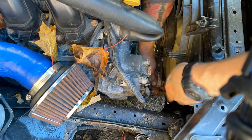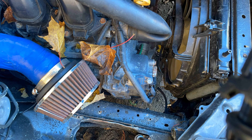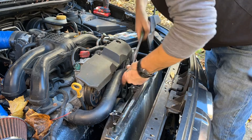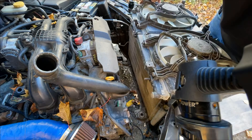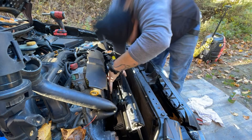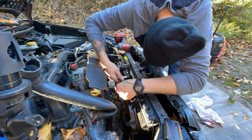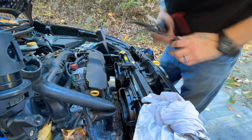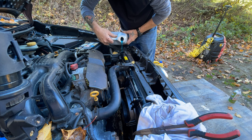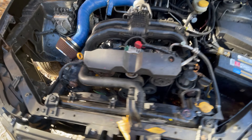What I'm going to do is disconnect the electrical connections and pull these bolts out to get the fan out of the way, then pull the hose. You could leave the fan in there while you do the work, but it's just as easy to pull it out because there's nothing really in the way. I pull it out just to give myself that extra room. The job is really like a five-minute job — very simple, minimal things to disconnect and reconnect.